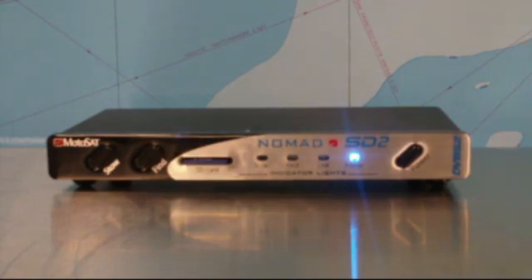Now you need to identify your system to your controller by telling it if you have a skewable or non-skewable satellite dish. In this case, you have a skewable satellite dish, so press the stow button to toggle the LED on.